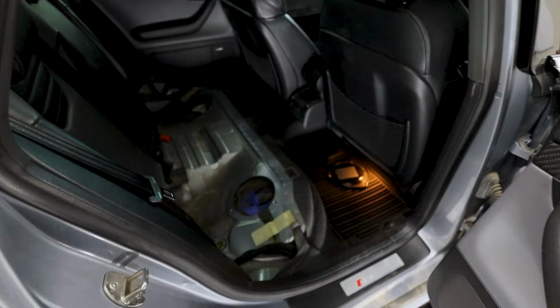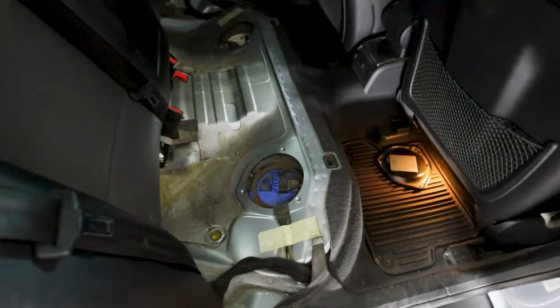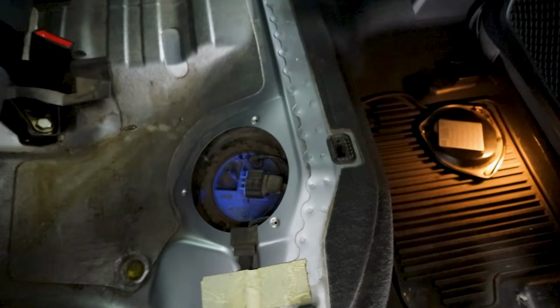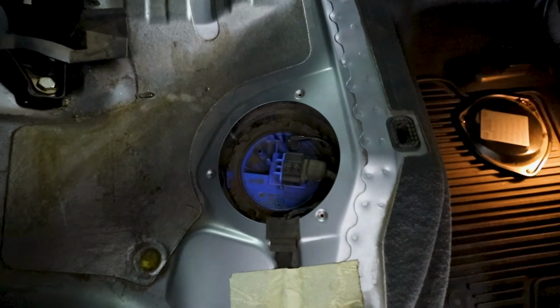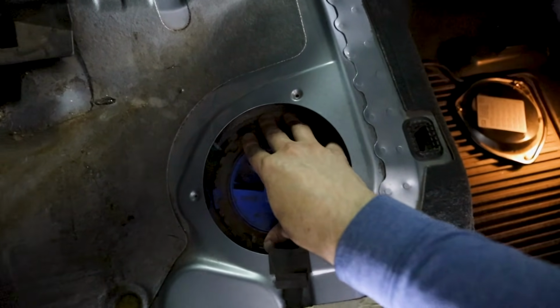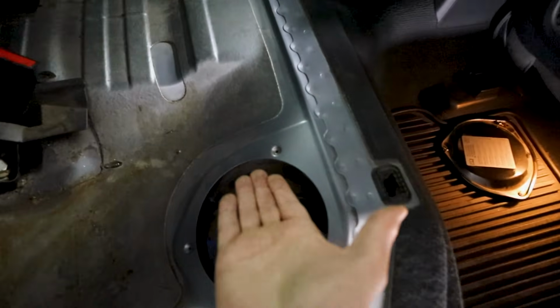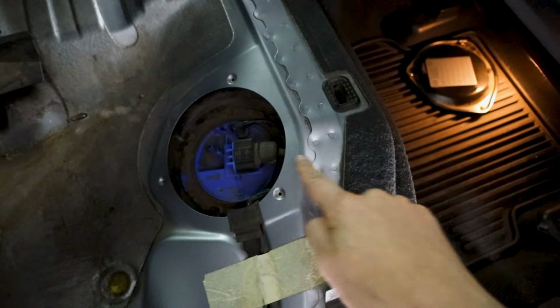And the entire purpose of doing that was so that you can go into your back seat. Obviously you need to remove the rear bench. You can do that just by slipping in your hand here and pulling up. There's only 2 grommets that hold it into place. Take off the lid cover, no big deal there. Because now you can actually get some play in the gas tank. You can push down from above, like that. Helps give you a little extra room because ultimately you're trying to slip in your hand and more than likely you'll be working to get hoses down from this direction.